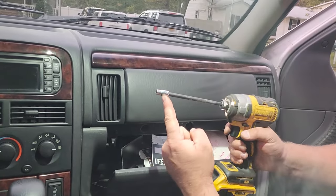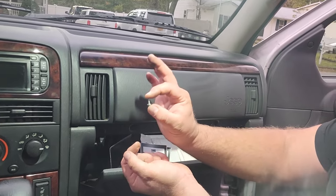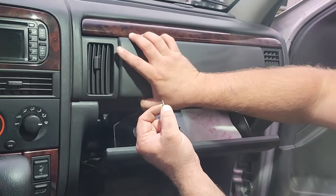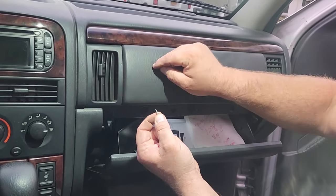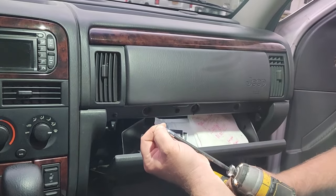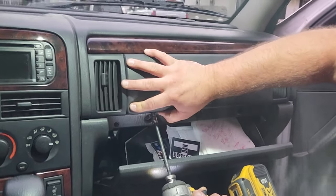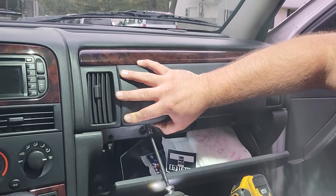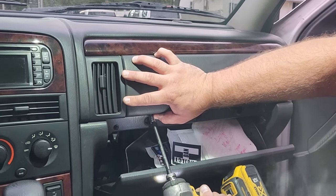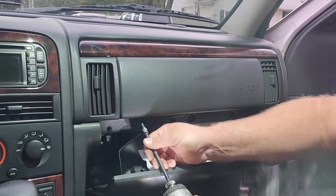We got ourselves a quarter inch drive, quarter inch socket, and we got a quarter inch self-tapping screw. This is teeny tiny, guys. We're gonna pin these screws right into this plastic frame that's on this dash. Now we want to use short screws because remember there's an airbag behind this piece. So we're going to go ahead and start the pinnings now. All right, we're going to line up a spot where we want to pin it. It's going to hide itself nice and deep into this foam. There we go. Make sure you push in on this pad so it sucks up nice and tight, and that's the first one.